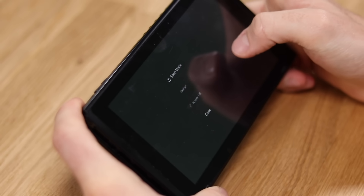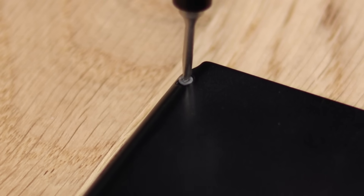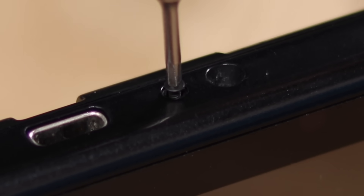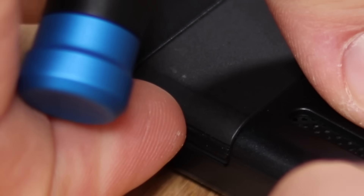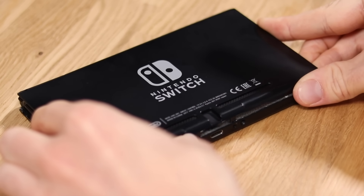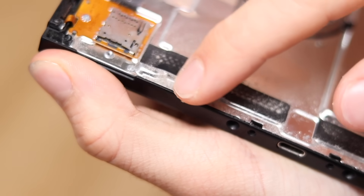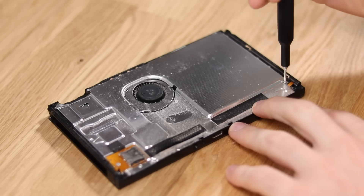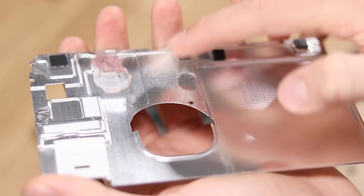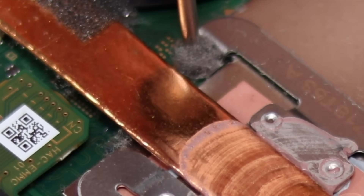So I'll start by removing the Joy-Cons and turning off the Switch. Once that's done, I proceed to remove a screw, then another screw, and then another screw — several more screws follow. Then you lift the back off. It's dusty — I'm playing with someone else's skin cells. Then you remove a few more screws, lift off the metal shield, unplug the battery because batteries are scary, and then remove the cooling system.